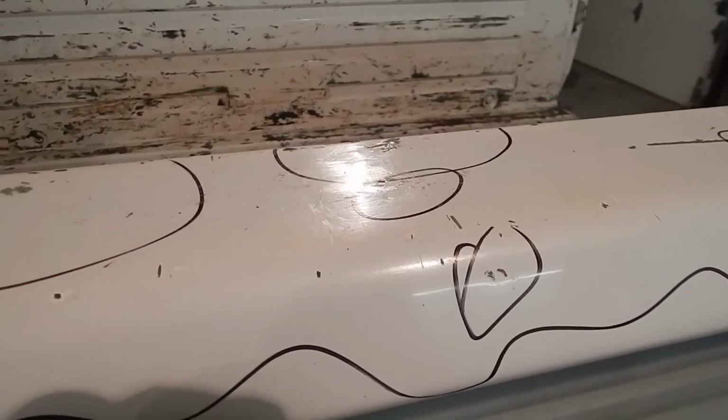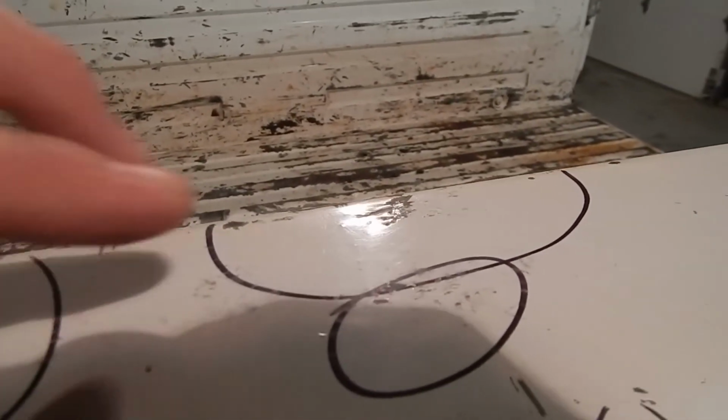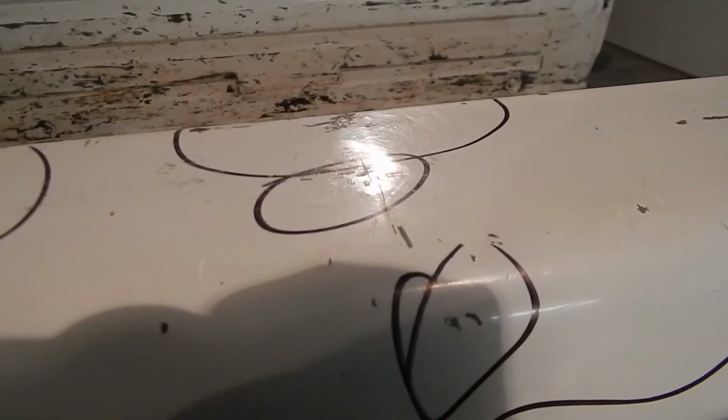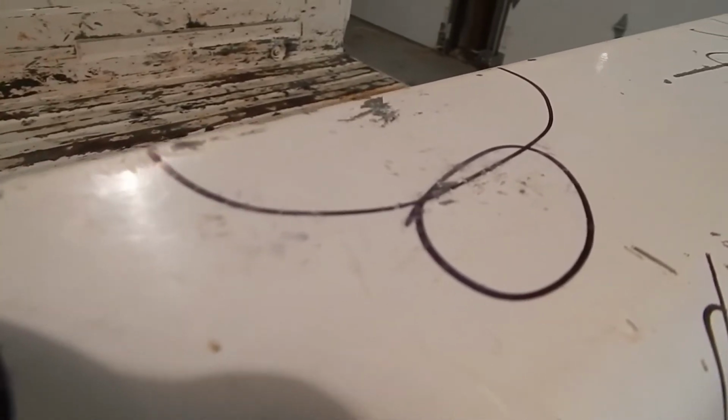Before we grind into this, I just wanted to show you, these are the 2 dents. That right there is where we were at earlier, that we were 1/4 inch low. Guys, that's going to require almost no filler. And we honestly fixed that with a little bit of hammer and dolly, but the main dent removal we did there was with a chrome extension for a ratchet and a ball peen hammer.